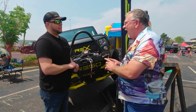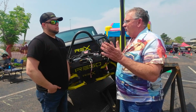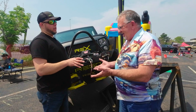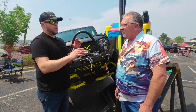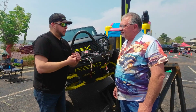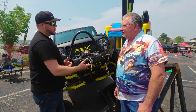Now, if you didn't catch all that, let's reiterate a couple things here. You're talking about not upgrading to a 60. You're using the original Dana 44, which most people would be like, well, why? That's going to be your weak point. Right. But with portal axles, with the gear reduction, it reduces all that stress in that drivetrain. And that driveline bind goes away. But also that driveline hard loading that snaps your joints, right? So this way, you get RCV axles, which are the best anyway.